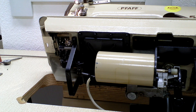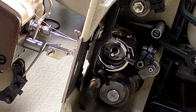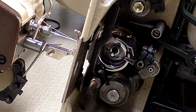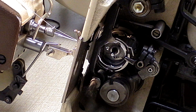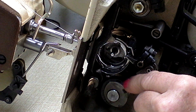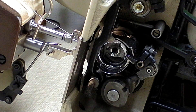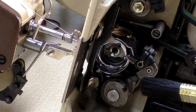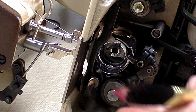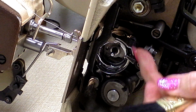Now I'd like to share one of my favorite tips. Before you start your cleaning, when the machine is really filthy and dirty, do a little sample sewing — just 10 centimeters. Not because of the stitching, but because of the sound the machine makes when you're sewing. Exactly the same test you will also do when your machine is totally clean and oiled, and you listen to the sound it makes then. You will not believe the difference — because of the dirt that was in the machine, it sounded hard and heavy. After you've done what I'm showing you, your machine will sound smooth and quiet and run easily. That sound will tell you it's feeling so well after the treatment. So make sure it's really clean — go with a brush or blower through again to make sure.